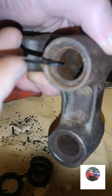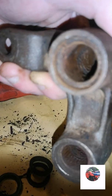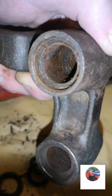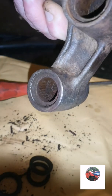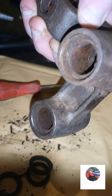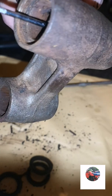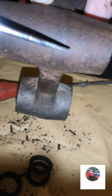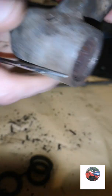there's two brass bushes. There's one there. When I take this pick away and it focuses, there's one at the other side. You can see a gap in the middle of them. That's for the grease pin what goes through. You put grease in, and the hole in the grease pin lines up with the gap in between this brass and this brass spacer, so the grease would be coming here, same as this.